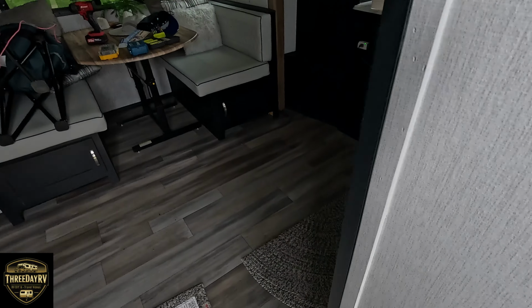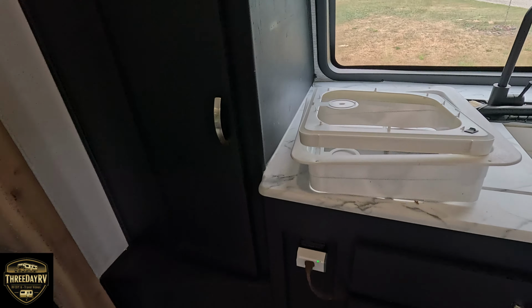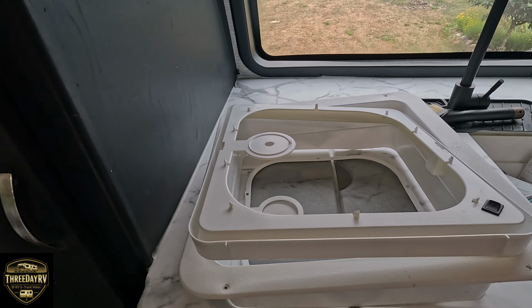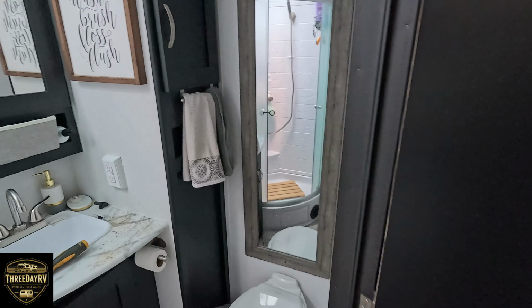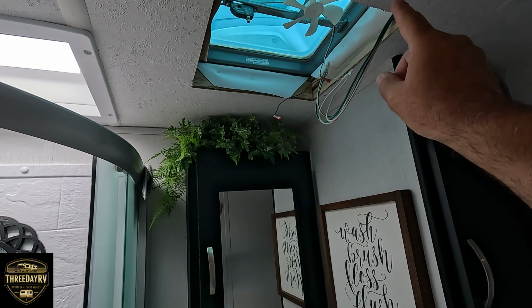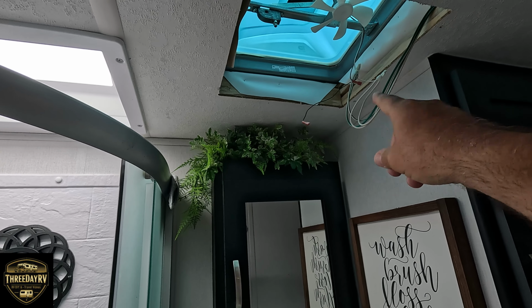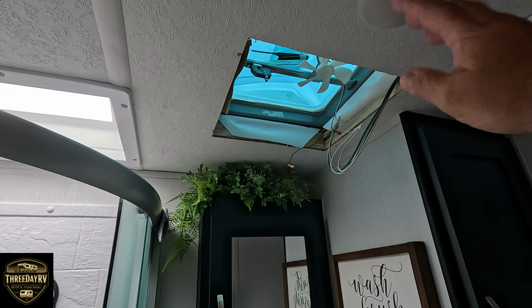I was waiting for the GoPro battery to come up. I went into the bathroom and I took these pieces out. I'll hopefully still have that clip to show you, but it only has 4 screws. There's 4 screws that hold this in, 4 of those little square head, and this whole flange comes down and you unplug the switch from it. And that's it on the inside. That's all you have to do to take it off. 4 screws, drop it off.